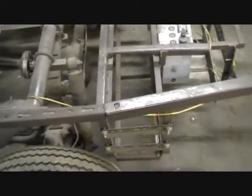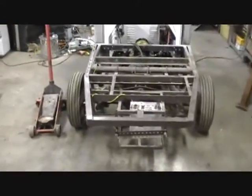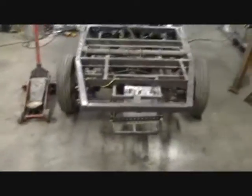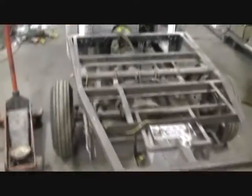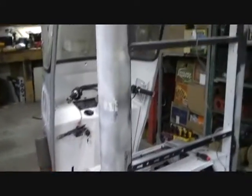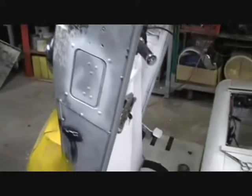Those are all in parallel to get them all charged up right now. Looking over here, this means that my battery configuration tray is not going to work anymore, so that all needs to be redone. Given the weight and what the aerodynamics of this thing are going to be once the walls are constructed — which will go up and parallel those, have a roof, will come to a boat-tail sort of configuration here at the end — and the roof will taper down at about an 11-degree angle as well. That should get me in the 50 miles-per-charge range with regenerative braking — hopefully considerably more. Those are very, very conservative numbers, so hopefully we'll see more than that.